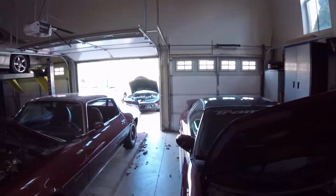This did turn out to be correct. The bulbs that Late Model Lighting gave me, these L-shaped ones, they're just not going to work for that car. They're just not going to. So I replaced them with the straight shot bulbs that I bought off Amazon. They were 32 bucks, something like that. They went right in the Late Model Lighting housings, and they plugged right into the connector, the 9006, and they work. You can see the headlights are sitting nice and flush now.